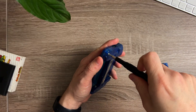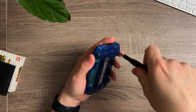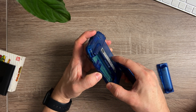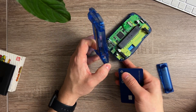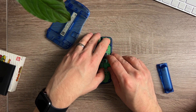It's not too difficult to open up. There are six T6 screws on the back, and the only tricky bit are the two clips on the bottom, either side of the battery latch. So you just need to be a bit careful when opening that.